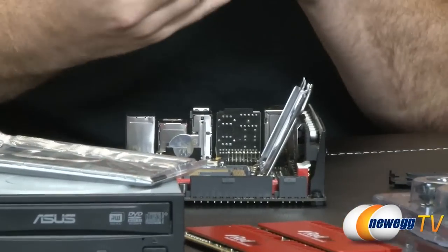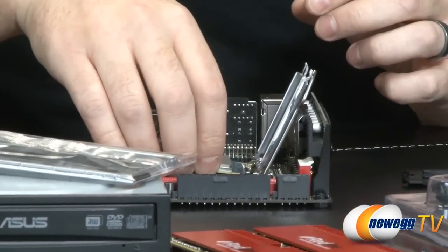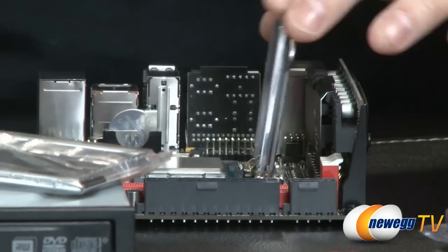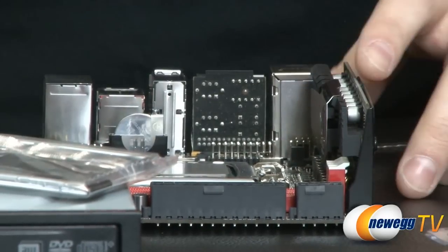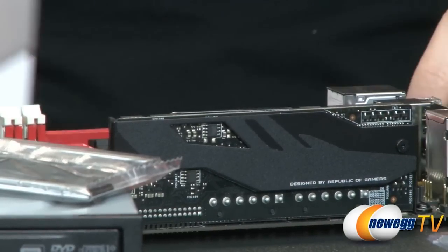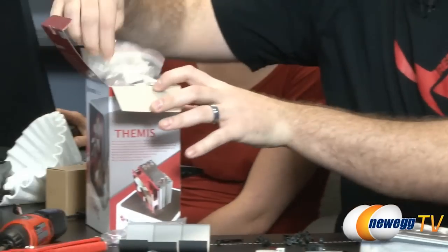Oh, here it is. With the i5 4430 bottleneck in Asus 760. That's actually a pretty solid, you said 4430, right? Yes. So you're going for a little bit more of a budget build, but that's a really strong part. Overall, the performance is going to be pretty solid. I will note, in some titles like Skyrim actually has a really great load balancing engine for more cores and more cache. So if you give it a beefier processor, it definitely does better. But overall, I'd say that's a pretty well-matched CPU for the majority of GPUs. So if you're on a budget, that's probably one of the best budget CPUs to buy, short of even a cheaper part like a 3300 or something like that.